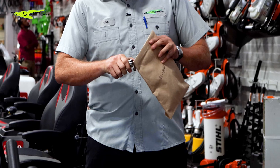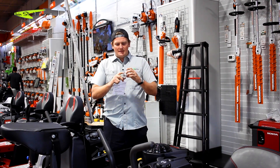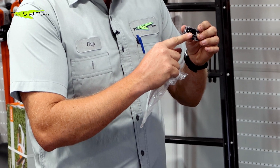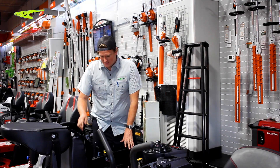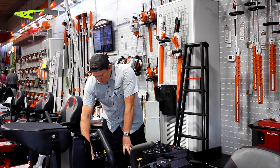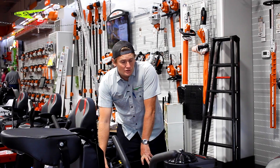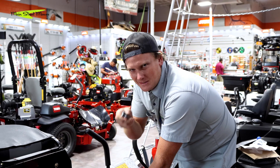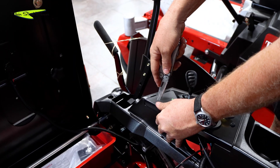If we open this up there's just two items in here: a small instruction manual and your hour meter. The hour meter just has three prongs on the back and you're only really going to utilize two of those, and it just clicks into place. First things first, I'm gonna have to cut out where the hour meter is gonna go. Basically you're gonna feel this sticker right next to your throttle — push down and you'll see the rectangle appear, then you're gonna cut that out. You can use a razor blade or a sharp knife — I'll use my handy-dandy Leatherman. No sponsorships yet but come on Leatherman, hook me up. Basically you do a little X-pattern from corner to corner and then trim out the rest of the square.